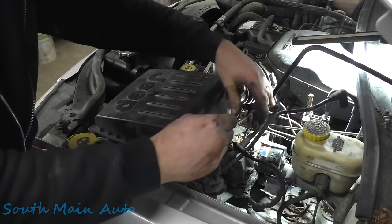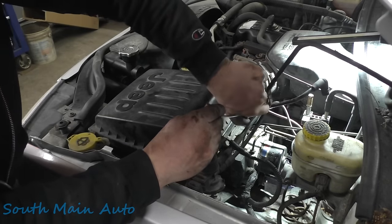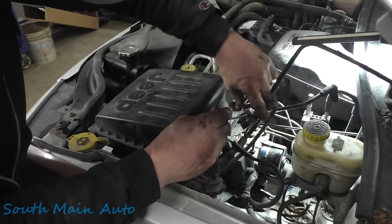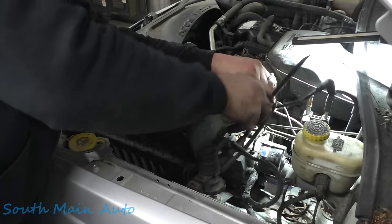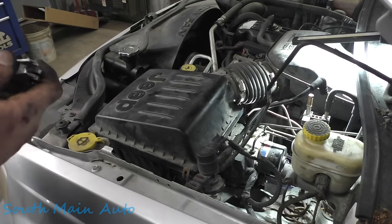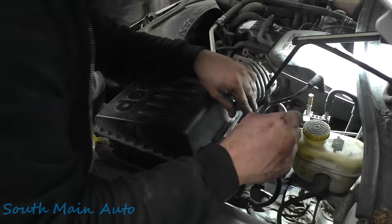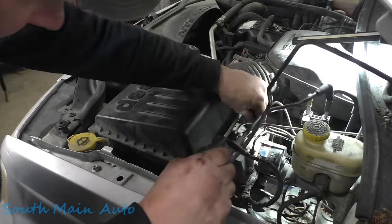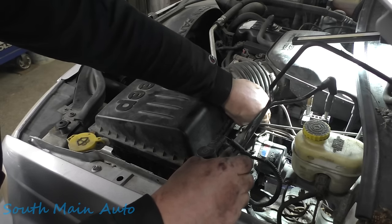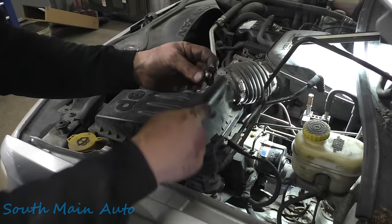I was able to manipulate it up under that steering shaft and get it back into the factory holder there, whether it was for this line or for the rear line, I don't know. But we've got it snapped in that groove. And we're a long ways from the steering shaft. We've got it running right up with our other line. So let's take this fitting out. We'll knock the line out of it, and we'll get it flared on this line.